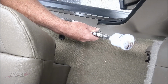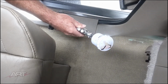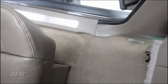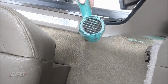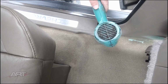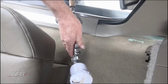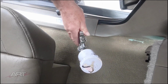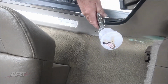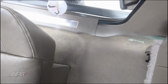Here I'm spraying down in the roots of this red stain right next to the plastic, so I'm going to end up spraying the plastic too. There's no need to use masking tape here. It probably won't stick anyway, typically. We're just going to clean that off. And that's easily done if we get right on it quickly. And of course our blending coat. A little bit more paint, still high pressure, just a fog, just a mist. That light spot you see, that's the sun shining through.